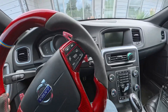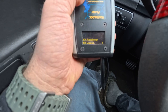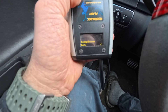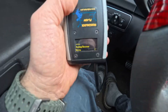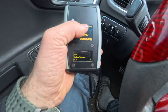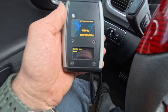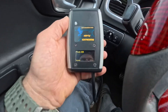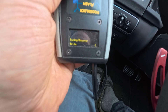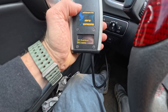Now I'm actually going to show you how I do this. The car is off — you can see I just plug it in. It says decode, flash, log. I go to flash, select Denso Petrol for the P3 — mine is regular Denso — then choose read, backup, or write. On the laptop you want to make sure you name your file correctly so the device knows which file to flash to the vehicle.